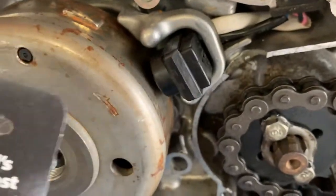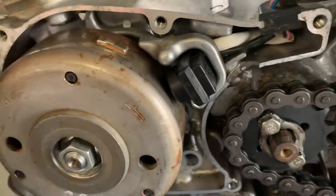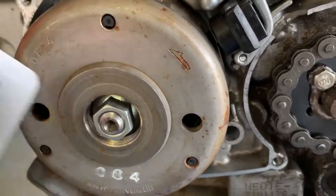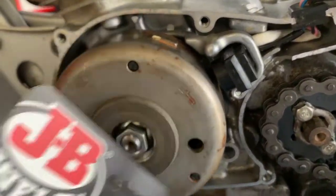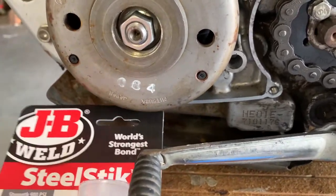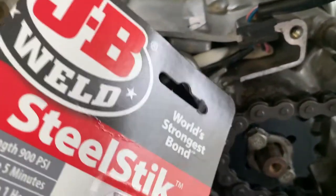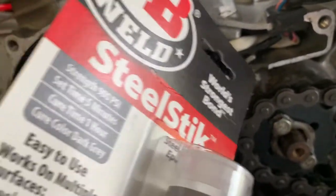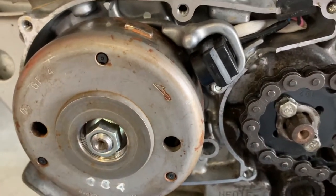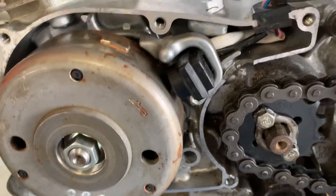Really all I'm looking to do is keep these components dry. The gasket seals all the way around this housing, and basically it's to keep these Honda electronics from getting too muddy and too wet. There is a weep hole at the bottom when you seal the gasket so moisture can drip out if water does get in. I was more afraid about mud — we ride in mud and the direction this chain goes, it shoots right in here. So I'm going to patch it up.